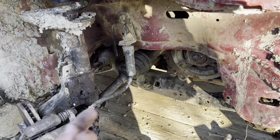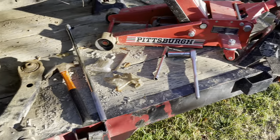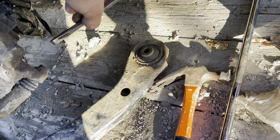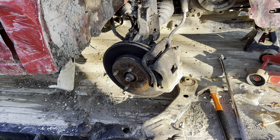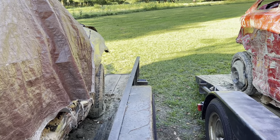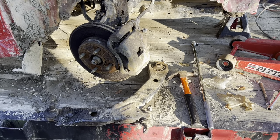The centerpiece just slides right out. Used the torque wrench on that big bolt - it had quite a bit of torque - and the front two were the same. Pretty easy with just a basic socket. I put a screwdriver in between where the ball joint was to tap it and just kind of separate it a tiny bit, and the ball joint dropped right out. I pulled it out without even having to loosen up much. We're going to take the CV shaft off as well since I put it on this car - it's got the aluminum spindle versus the steel Cavalier spindle. We'll keep the CV shaft in case we need it in the future.